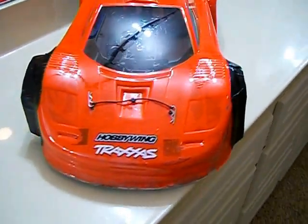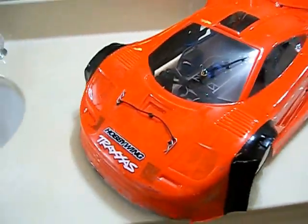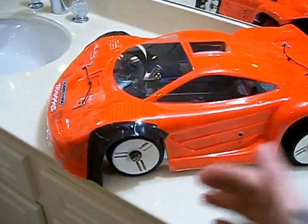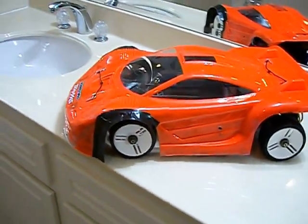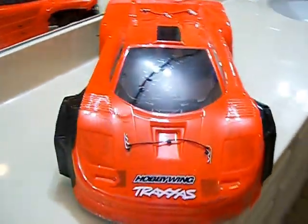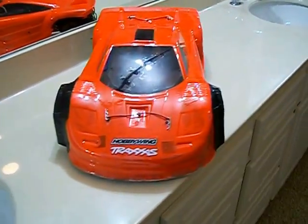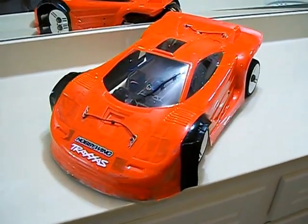I built these fender flares to hopefully redirect the air as much as possible around the front wheels. In open-wheel vehicles, the wheel spinning causes a lot of dirty air, and that's extremely bad for aerodynamics. I noticed that during my runs the front wheels tend to be a little past the body. So I built these little fender flares to hopefully clean up that air and help me aerodynamically. This body is kind of my test mule body — I'll be ordering another one to trim it out better once I get everything tweaked to get the body as tight as possible for aerodynamics.